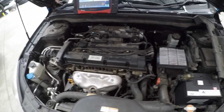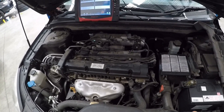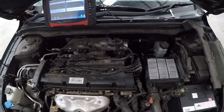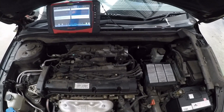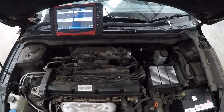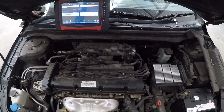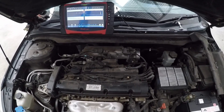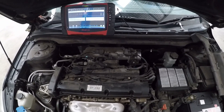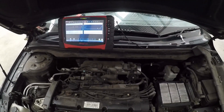The first thing I realised when I came out here was this is not a mass airflow sensor car, it's a MAP sensor car. With a MAF sensor car, if there's an intake or vacuum leak at idle, the short term fuel trims go high to add fuel because it's running lean. With a MAP sensor car it can be the opposite - losing vacuum loses a reading on the MAP sensor, so the engine thinks it's getting more air and puts more fuel in. So straight away, that reading at idle, I'd be thinking we've possibly got a vacuum leak.